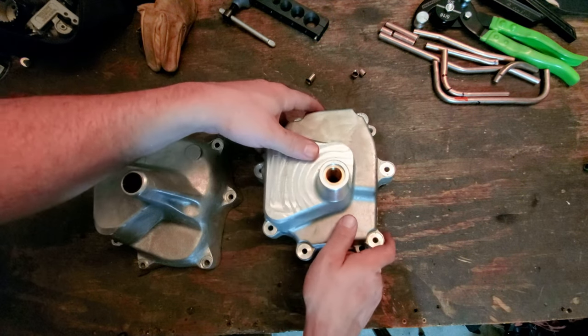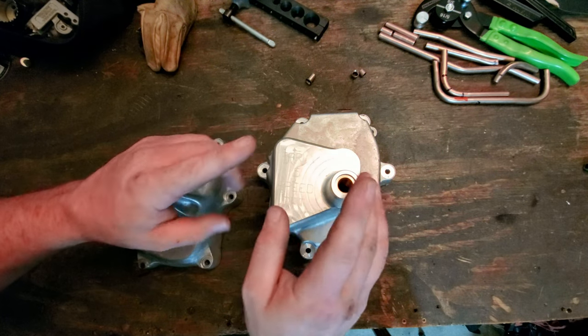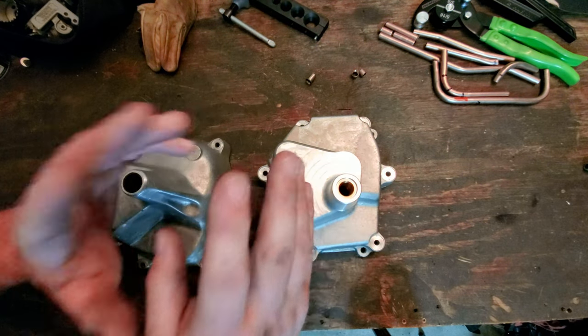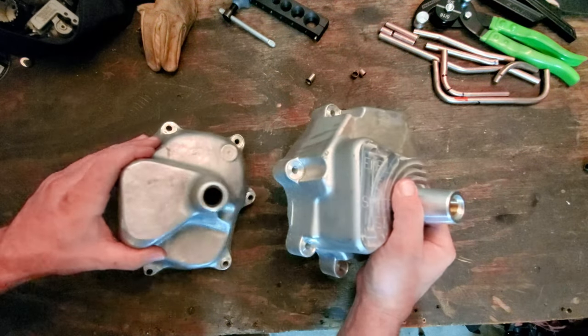Now that's also going to help with your shift rod and your coupler alignment. And all you're really going to have to do is figure out where your little dimple goes, the little one you put the grub screw down on that shifts into this thing. So you have to play with that a little bit, but a lot less of a headache, guys. That's the update on the BERG 5-speed.